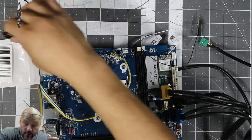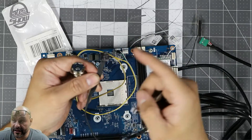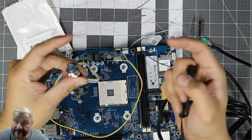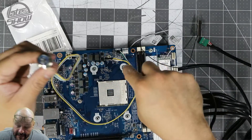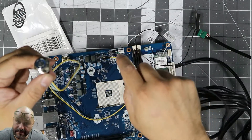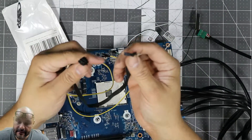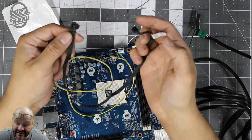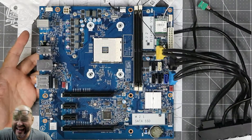Instead of the original button that comes with it, if you can't migrate the reset button or if you can solder it from the original to the tower, go ahead and do that. But my best recommendation is to buy a reset button — something fancy or something simple — or take the existing connection and plug it into that slot. Unfortunately you're not going to get the LED plus or negative, just the power reset button. This is the original button that I migrated and took off — I still have it here for reference.